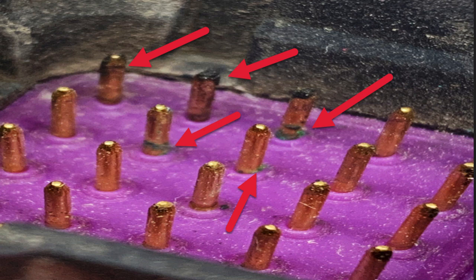We put it back together and never had a problem again. Take a good look at that because we missed it two or three times — looked right at it and never saw it. The way we finally found it was someone in passing said they wiped a small green circle off that was around the hole in the plug. As soon as they said green, the light went on. So keep an eye out — watch for that green. When it comes to electrical, it's a killer. See you next time on Engine Shop Joe.